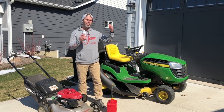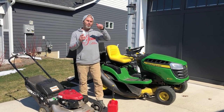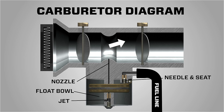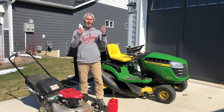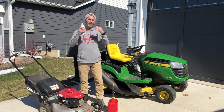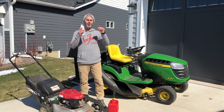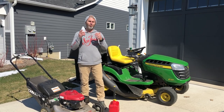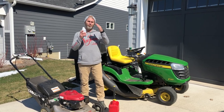They have a carburetor, and the way it works is fuel — gasoline — comes from the fuel tank through a series of carburetor circuits. It passes through a needle and seat into a float bowl, then through a carburetor jet and through a narrow fuel nozzle where the air intake pulls that fuel mixture into the upper engine where combustion happens. Anywhere in those circuits, particularly in the carburetor jets, you can get gummed up fuel or varnish that restricts fuel flow.